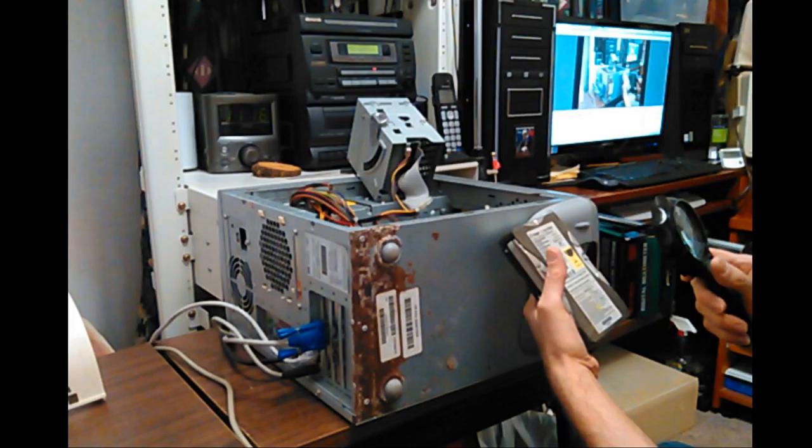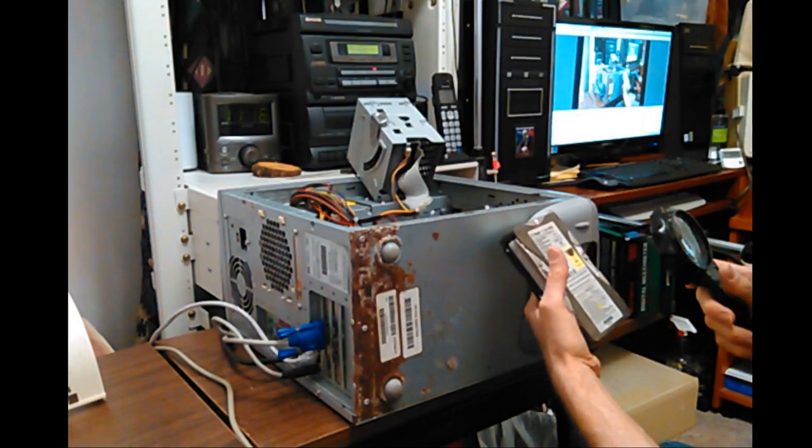it's actually numbered 1, 3, 5, 7 and above, and then the bottom, or these are the pin numbers, I guess, 2, 4, 6, 8. It's sort of like the firing order on a Chevy. Only they're backwards. So anyway, that's for Chevy 350. But anyway, if both of them are on the far left, that would be master with a non-ATA compatible slave. So it's on cable select, which is probably it.